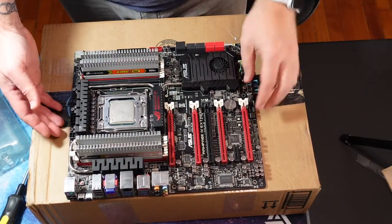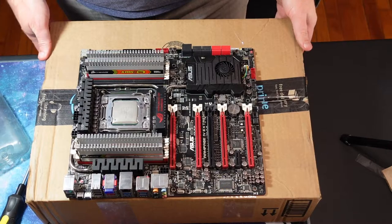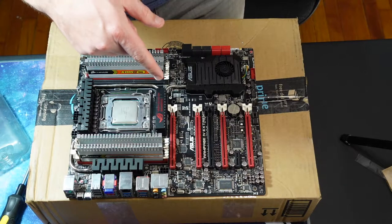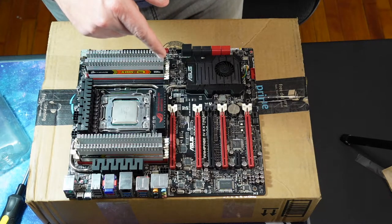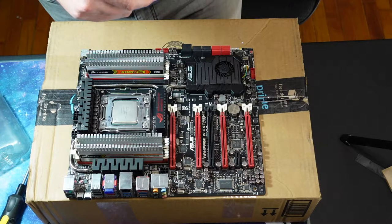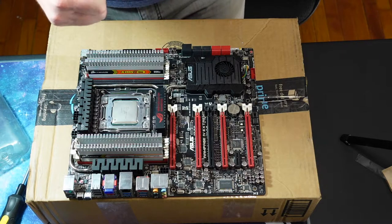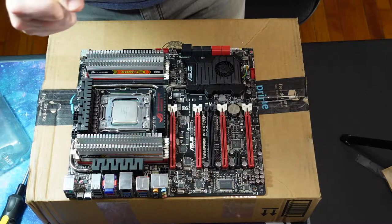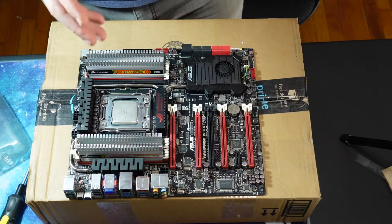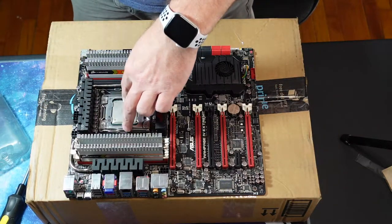I'm going to get the power supply. In this case, I have a new power supply. Because the graphics card I'm going to be using is a 3080, and that card can draw a lot of power suddenly, and older power supplies aren't equipped for that. So I made sure to get a new one from a trusted brand. It was the cheapest I could find in the 650-watt range, but also from a brand that I trust. Power supplies have come a long way. It used to be no-name brands are really bad, and you could kind of tell by the weight of the power supply how good it was, but with the certifications and everything, things are pretty standard. So I'm gonna go grab that and we'll set up the power and then we'll put on a heatsink.